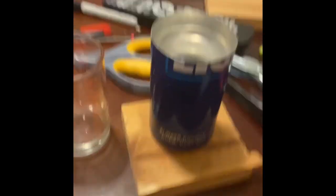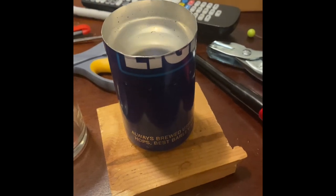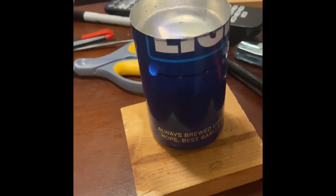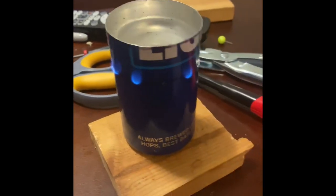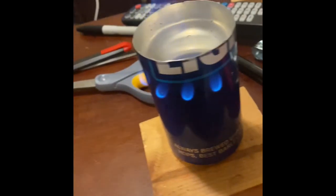That's really all the tools needed. Let me go ahead and put this down while this begins to prime — it's about a two-minute prime. It actually went pretty quick, about a minute. You can see it's already putting some fuel up there, and that has to do with that little insert, the capillary action. Without it, it takes much longer.